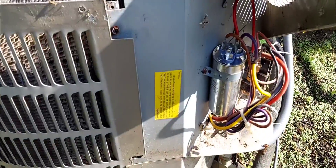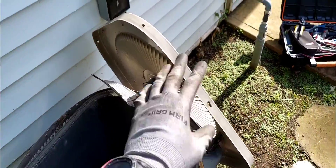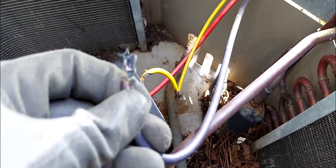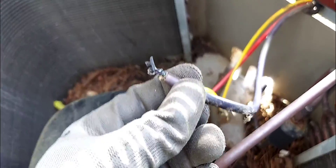If you're a pro you should know how to test for continuity on your resistance scale. Once I found that, I removed the cover — took the top of the condenser off. And by the way, this thing needs to be cleaned, it's really dirty. Here's what I found — the reason I wasn't getting continuity on one of the windings is because this wire has been completely burnt off and fell off the terminal.